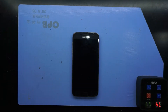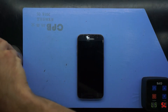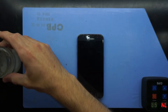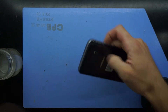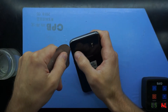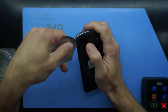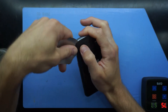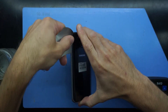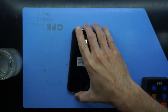So today on the table, I've got a relatively simple job to do. This particular one is a Samsung Galaxy S7 that has a very tinny, poor-quality earpiece speaker. What I'm doing right now is I've had it on the heat pad at 75 degrees Celsius for around about five minutes, so it's very hot to the touch. And I'm using a fine metal pry tool dipped in isopropyl alcohol to remove the back cover of this S7.